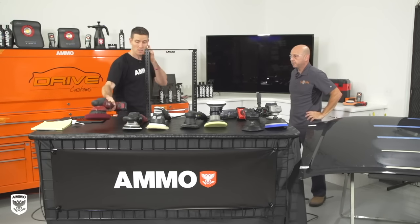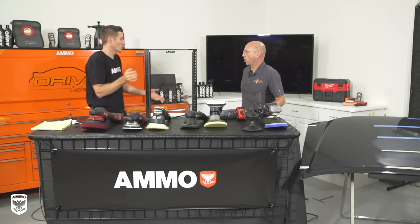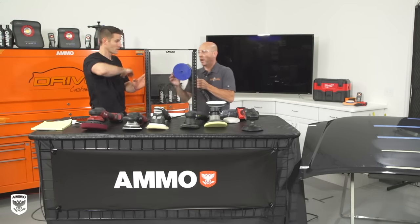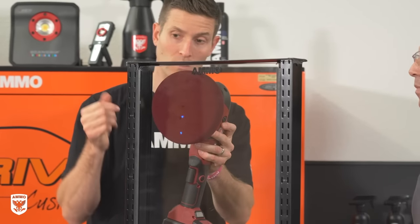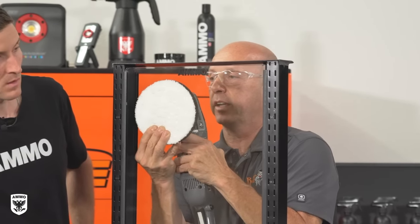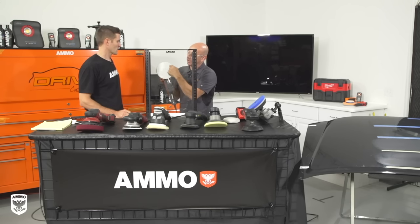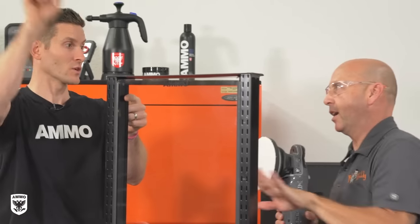Now a recap. The rotary: lots of power, lots of torque, very strategic depending on pad size and tilt. In a corner, the rotary stays on a fixed axle right where you put it — 100% contact wherever you place it. By contrast, a large stroke orbit is going to karate-chop at the edge. With the random orbital, the outer ring isn't getting polished as efficiently all the time — because it's random, you're catching that outer perimeter only every third pass. The rotary would have that same wobble effect if the pad were off-center.